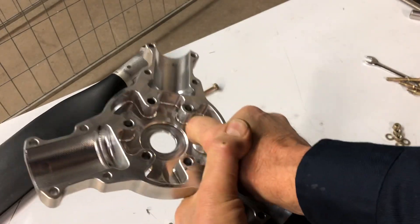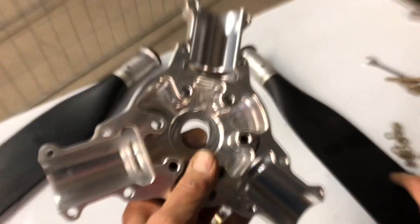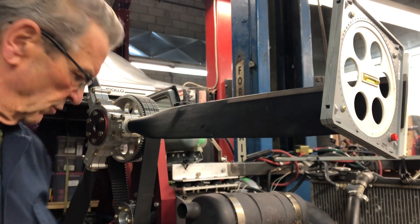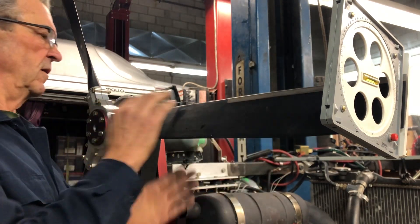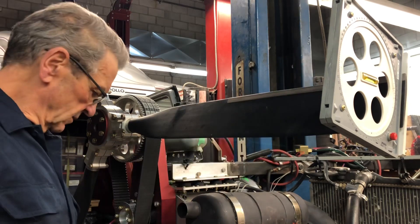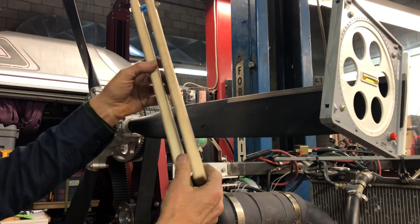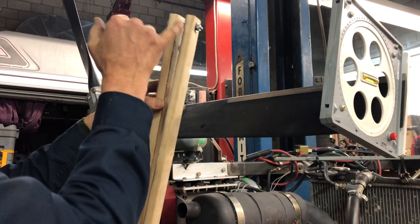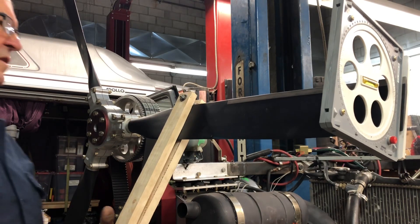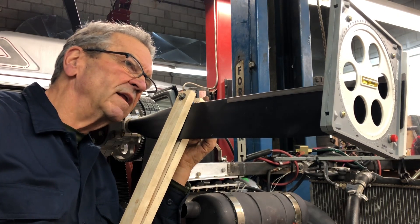I can almost squeeze that slot with my hand and make the blade stick. When using the Warp Drive protractor — it's an excellent device — I learned early on that if you bang the prop to rotate the blade, it'll actually shift the pitch setting a little bit even with the lock tight. So I made this tool here: two pieces of scrap lumber with a bolt and a pad in between. I just slip it over the blade and pinch it at the bottom.